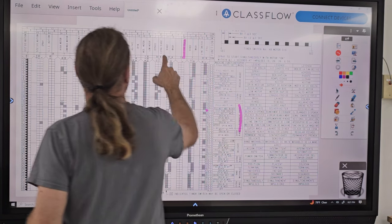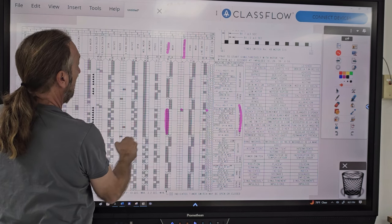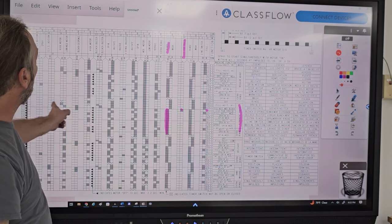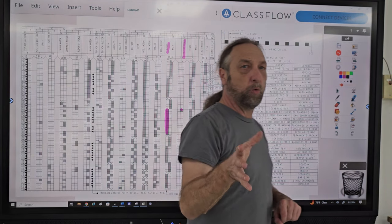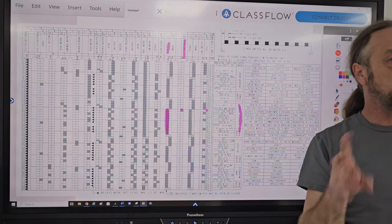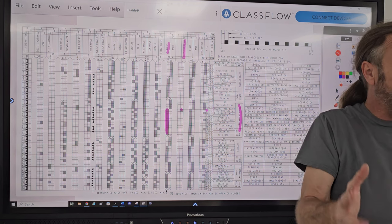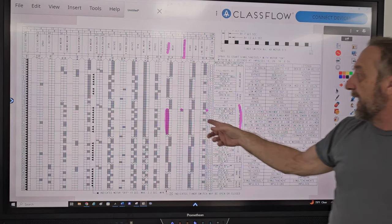If we find the rinse here, the rinse, look, it's energized right here. I was looking for a cold water here, one second. They don't actually specify hot or cold water. But the rinse here usually fills with cold water. So it'll half tub drain. It might shoot a little bit of cold water in there, but it lets the clothes sit and cool down a little bit before we go into spin, so we don't deform the clothes. And that's what a half tub drain is.